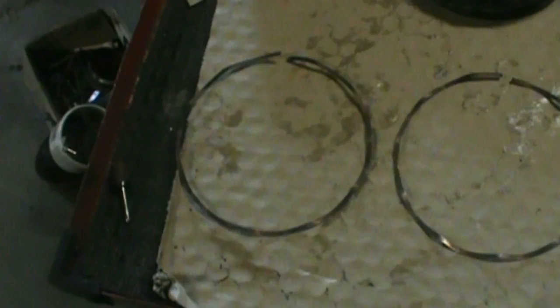like the rears will be blue and the fronts will be a cream color. If you're using your old ones, it's perfectly fine, but you just have to figure out which direction they're gonna go. So when they're sitting down like that, basically when the rounded tip is facing counterclockwise, that'd be front, like the cream colored spring, and when it's pointing clockwise here, that'd be a rear, like the blue.